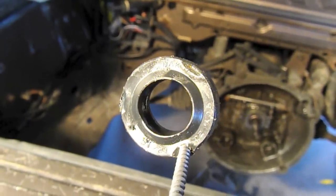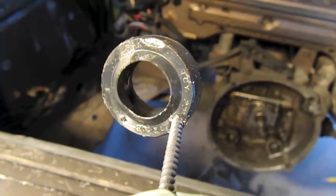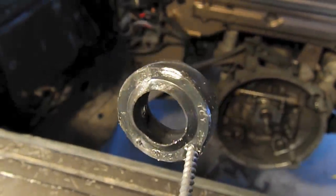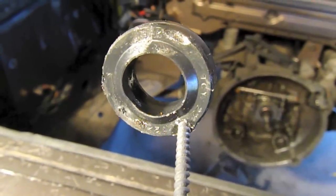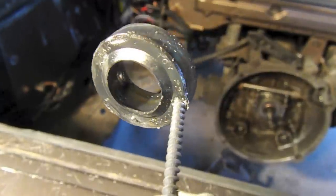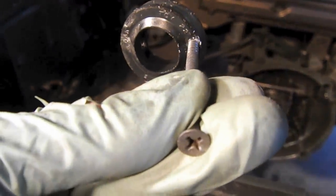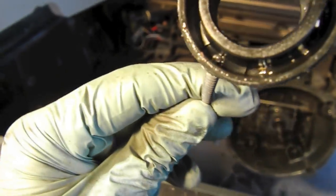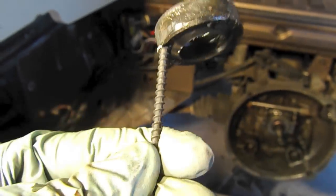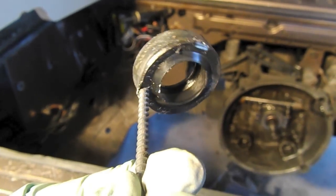Here's how I like to remove seals — I'm going to do the same with the rear main on the Subaru engine. Basically just take a wood screw and gently tap it into the meat of the seal, then use a screwdriver and just bore into it just a touch so it has enough bite. Then when you pull on it, you can use the claw side of a hammer — it kind of pulls it right out and no harm done. It's super easy and fast. Seal pullers just stink. Thought that might help.